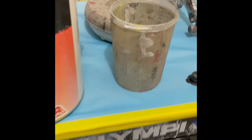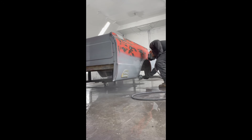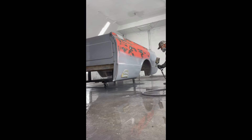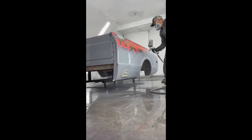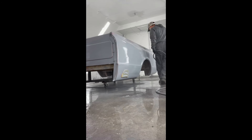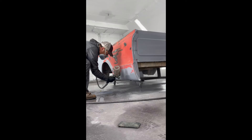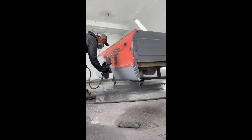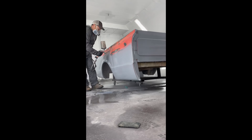The next thing I'm going to put down is the sealer. It's an inexpensive sealer — not something I use on customers' cars very often unless I have to. For this application it works perfect for this old C20 because it's going to be just a driver. It mixes 4-to-1. I'm going to put that down next, and then we'll be ready for the Summit paint. Through this whole process I'm going to use one gun — a Supernova Iwata with, I think, a 1.3 tip, maybe a 1.2 — from sealer to paint, super simple.